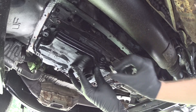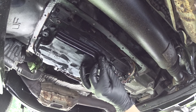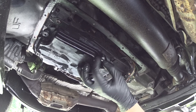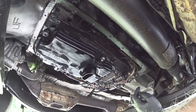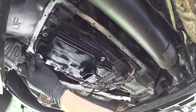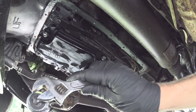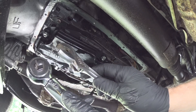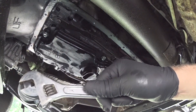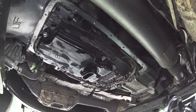Make sure the bolts are clean with no dirt. These filter bolts are torqued to 7 foot-pounds. If you don't have a torque wrench, I strongly advise you to get one. It doesn't have to be an expensive brand — as long as it reads with good accuracy, within about 1–2% or 3% at most. Seven foot-pounds is not much. If you're not sure how to feel for it, put a wrench on your torque wrench and try by hand — start at five or six foot-pounds and then move up to seven.